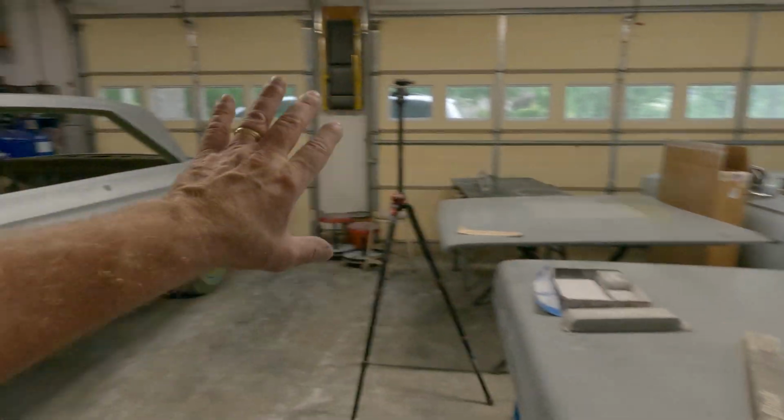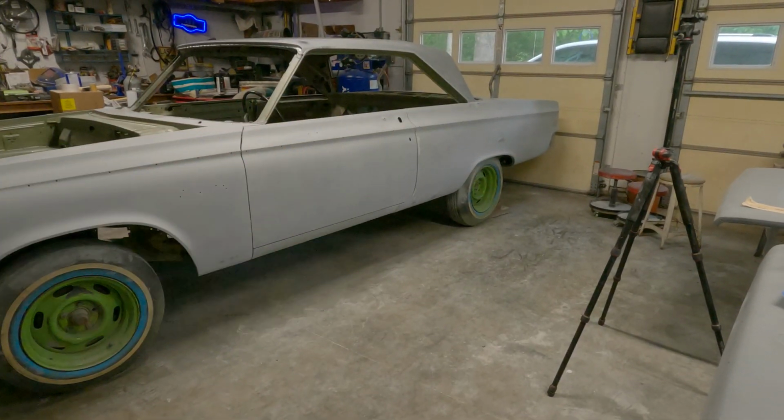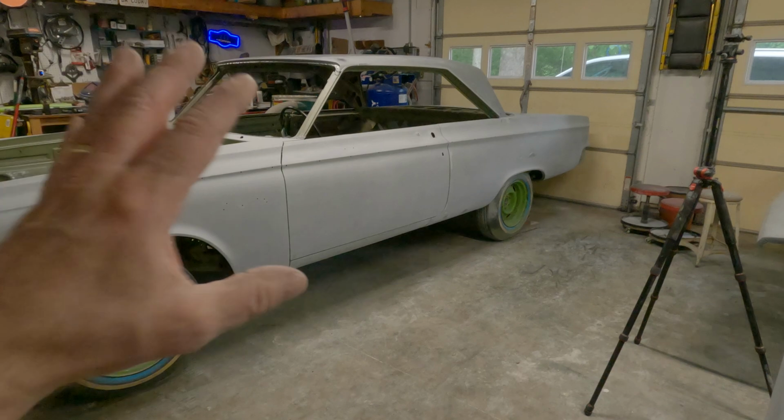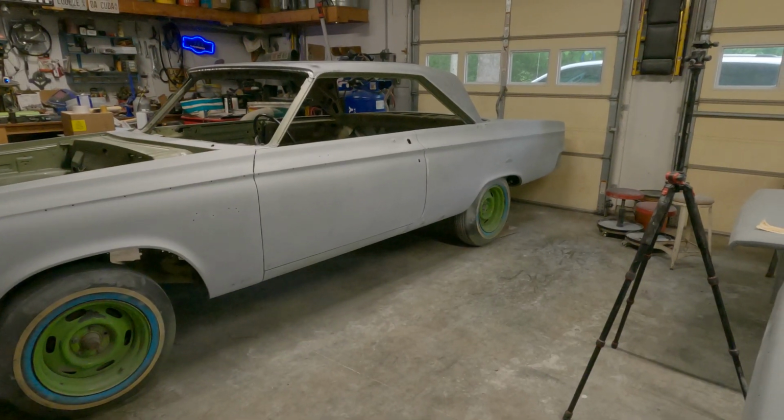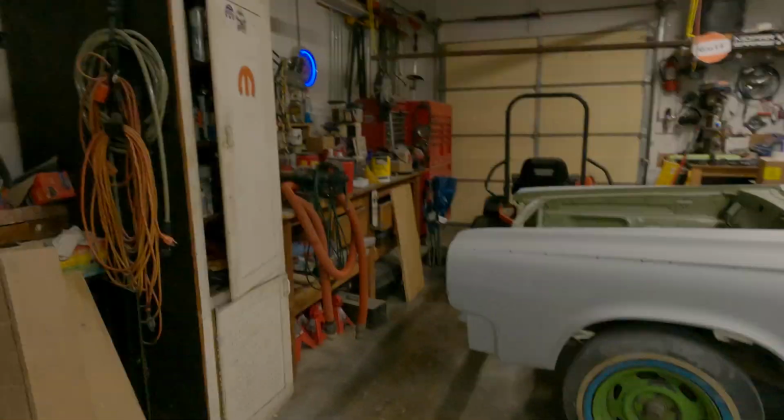Yeah, so that's it. Now, for me, this is not getting everything knocked down, and I'm going to go back with my fine-tooth comb, as fine as that comb as I have, and touch it up with the big blocks, and go across and do like Drew said, wet it down in the sun, see if we see some waves, and get the 220 really dialed in, and go from there. Probably won't bring you guys along for the wet sand, I don't think. You may see it in the background, because I do have other stuff I want to do.